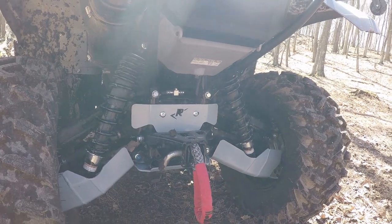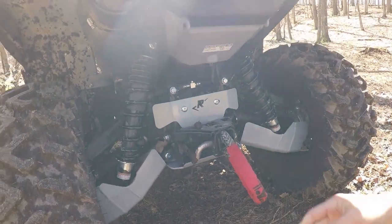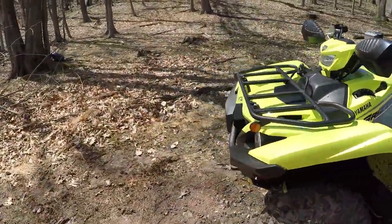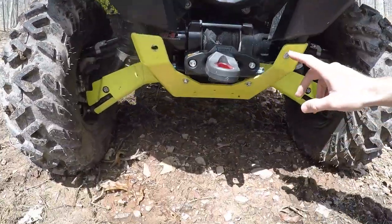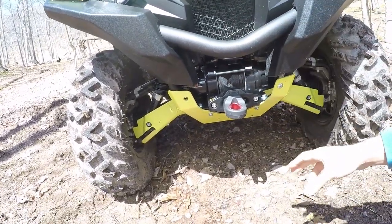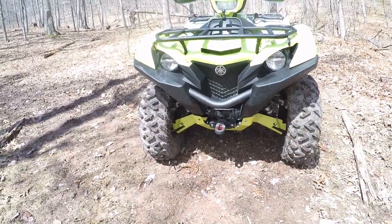I really like that these ATVs come with two-inch hitch receivers. This bracket bolts up in four spots on the back of the ATV — to me that is the only way to do a rear end on an ATV. I put a little device from Rugged Ridge in there myself, and you can also link up any type of recovery point you want on the rear end. The front end is a bit of a different story — I don't get why manufacturers don't put more recovery points. Normally you just get a plastic skid plate with no recovery point. I suppose you could put a rope around the front bumper, but do you really want to pull from that out of a deep mud hole? I would love to see a secure, strong recovery point where you could hook up a D-ring or a soft shackle for a proper yank from the front.